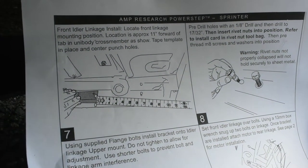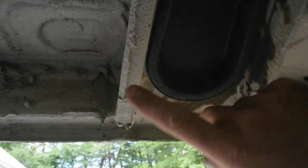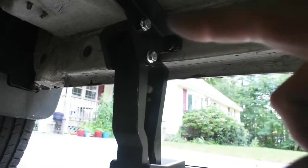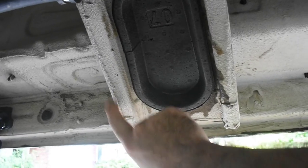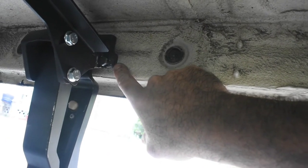The instructions say we're approximately 11 inches forward of a tab in the unibody cross member, which I think means this flange would land us in this space here, which seems right. Here's the passenger side forward idler linkage assembly installed. I used the 11-inch dimension from the forward tab — forward edge of this flange to the back edge of the drill template — and I marked and drilled the holes there. One thing I wanted to note was that I always put the nutserts in with Loctite. The bolts that go into the nutsert afterwards that hold the bracket on all get anti-seize.